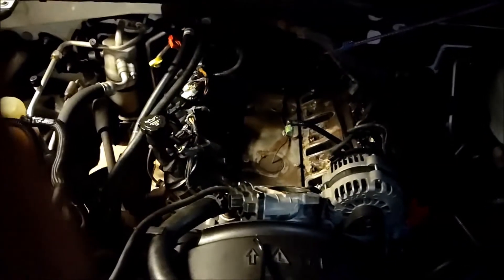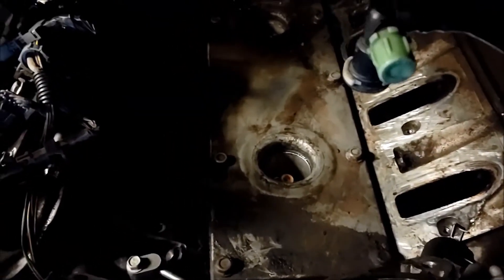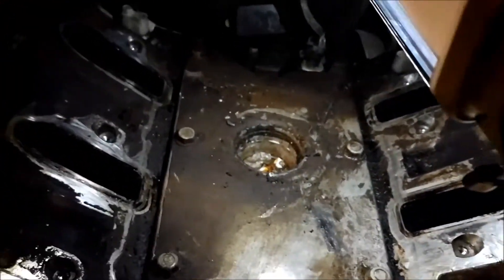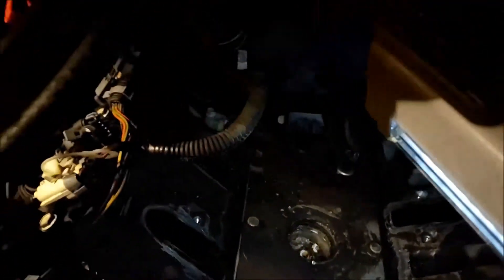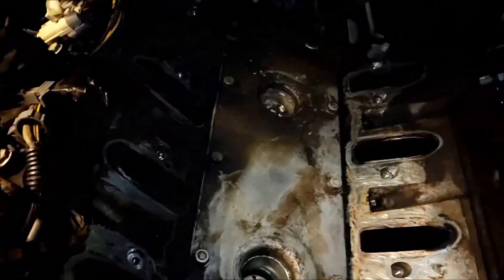So I'm going to have to get a new tube — hopefully the local parts store has one. But I got to clean it up and then get the knock sensors out next. Fun stuff. I got the wiring harness off the knock sensors and the computer was right — it definitely ain't going to get any signal from that one. It's full of ice and water. It froze — it's right full. You can see the front one there; that's what it's supposed to look like. The back one is chucked full of water.